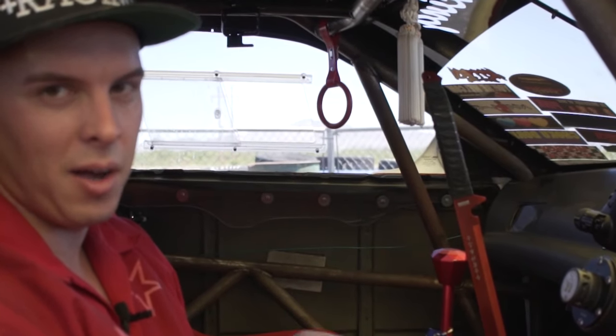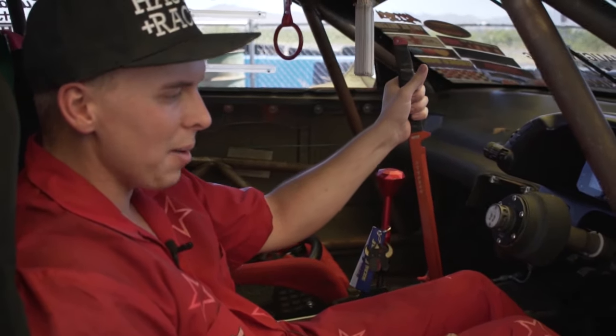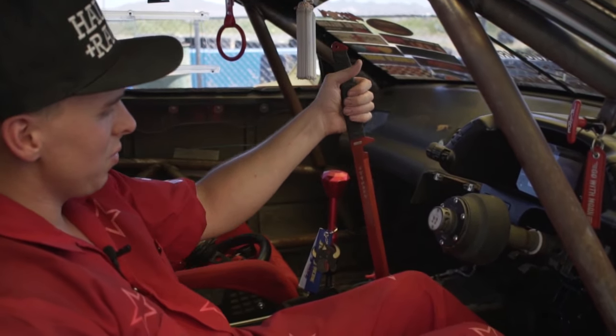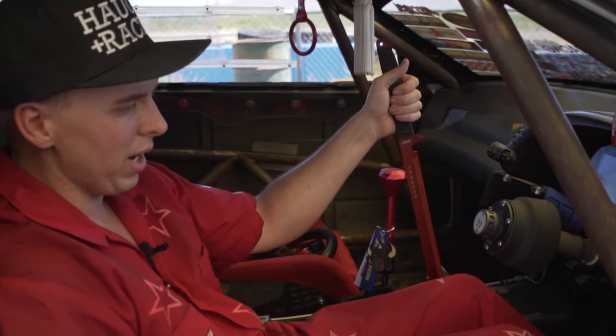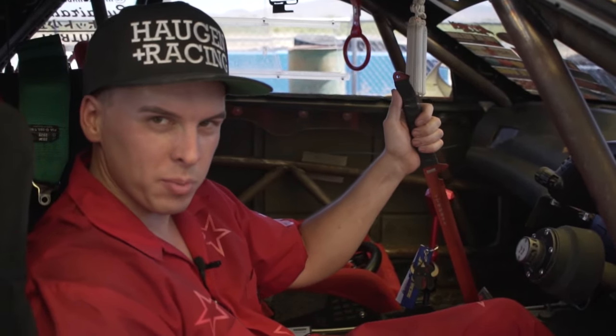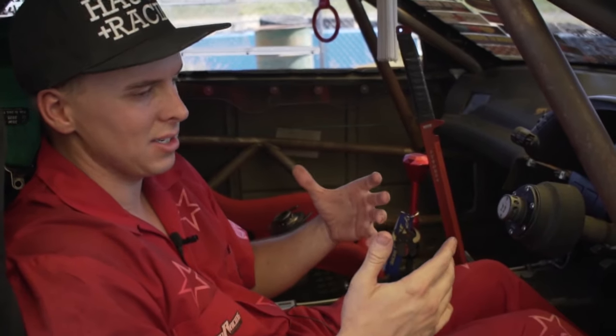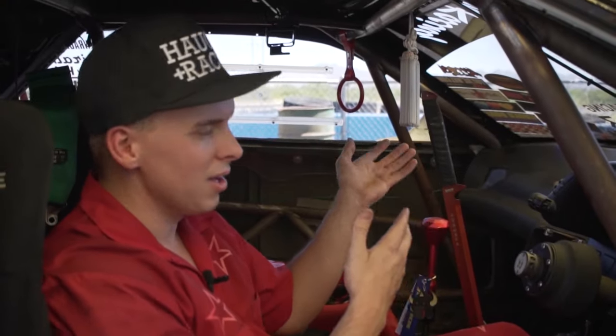So now you're actually putting a pair of second calipers on the rear end and they're separate brake systems. So what that does is now you've separated the brake systems in case of a failure. It's also sometimes when you have it in line and it's with the brakes, there'll be a little bit of a lag or it'll be tough to pull when you're trying to use the brakes as well. So that's pretty much the next upgrade. But again, all three systems work great and they do the same thing. It's just as you progress, you know, you upgrade this piece like anything else.